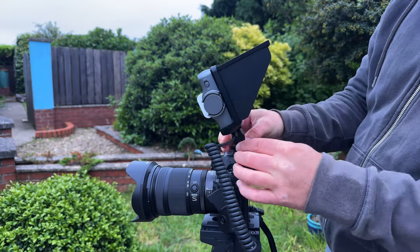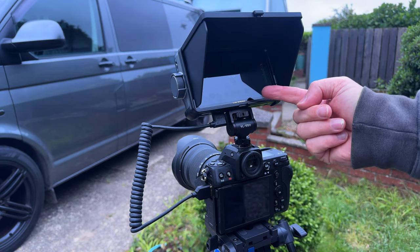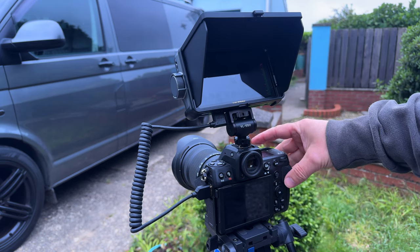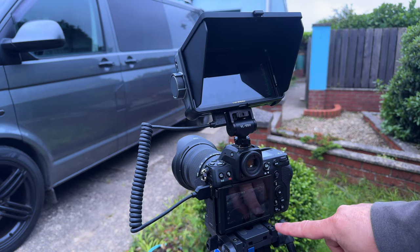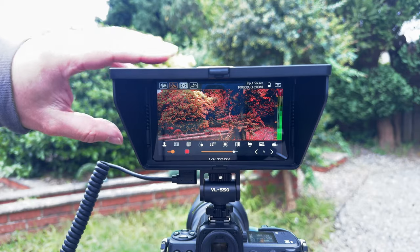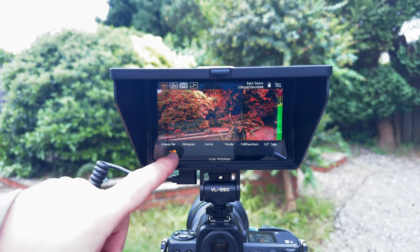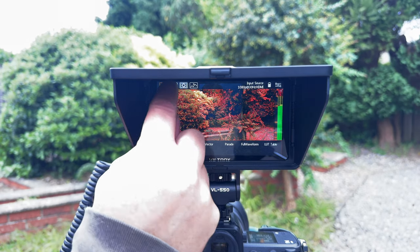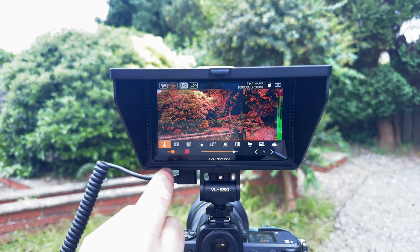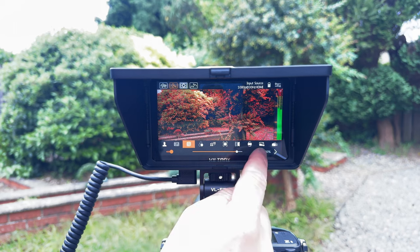If your camera screen goes to sleep and the monitor goes dark, the response time when you power the camera back up is about two seconds and you're back running. My preferred setup is: volume bar turned on, focus peaking enabled so I can see what's sharp, and zebras turned on — I usually leave them at about 90, which is good — leaving everything else as default.